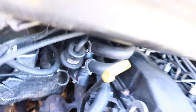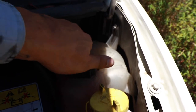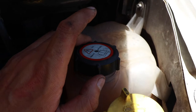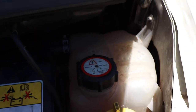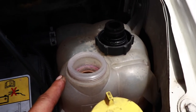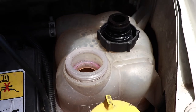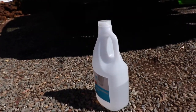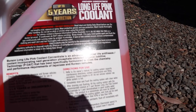We may potentially have to drain the coolant completely and reinstall. I just took the cap off — only do that when it's cold. Ours hissed a little bit because we were driving it this morning, but I'd left it for a good two hours by the time I had breakfast and did the oil change, so that was fine to take off. If it's been driving recently, definitely recommend leaving it for a while just to cool down so you don't spray yourself with boiling hot coolant. Also, if you didn't know, you can't mix brands or types of coolant, and this system is 10 litres so that's a fair bit of coolant.